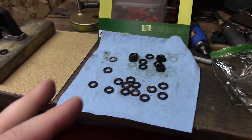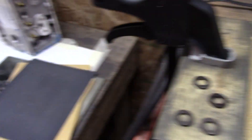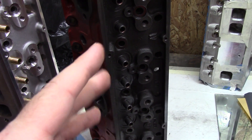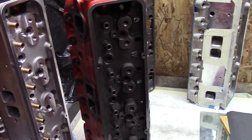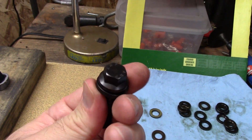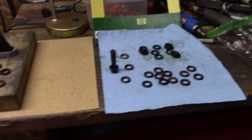I'll finish roughing up these washers. The reason you do this — beyond preventing thread damage — is for more consistent torque on the heads, so you get an even load. Other things that help: chasing the threads with a thread chaser (ARP makes one I like — avoid using a tap as it can be too sharp and damage threads), and using the proper lubricant under the head of the bolt between the bolt and washer so it spins on the washer while the washer stays put. All of these steps together make the bolt loading more consistent across the whole head.